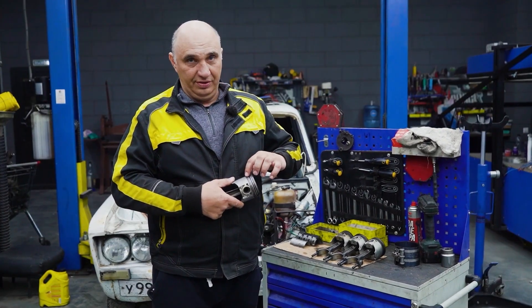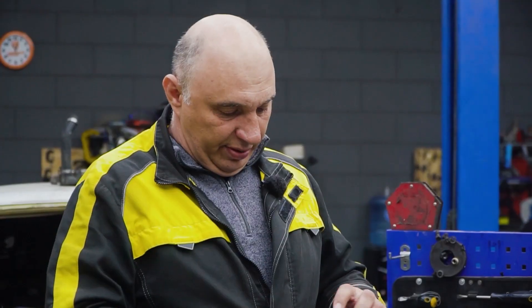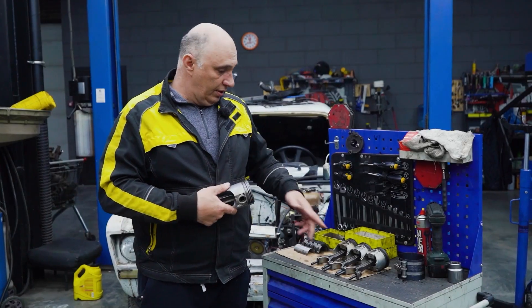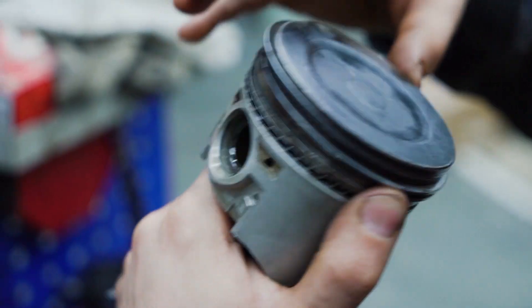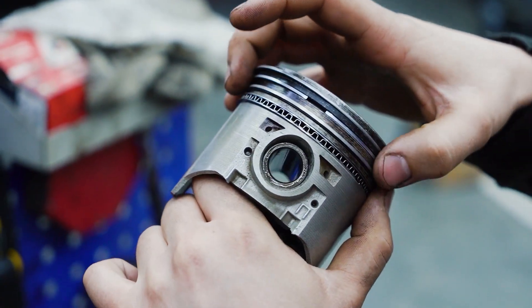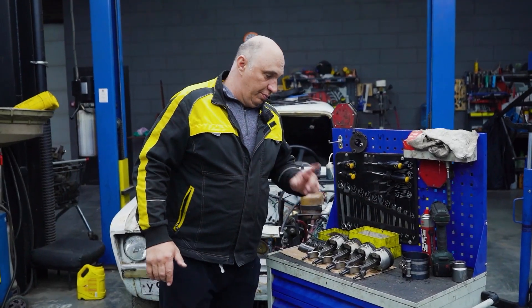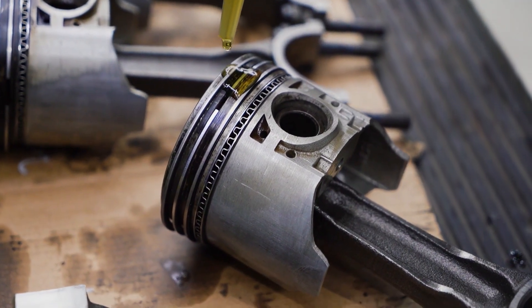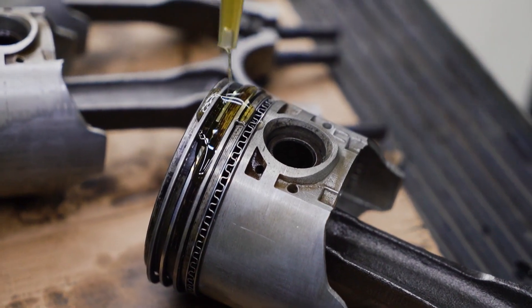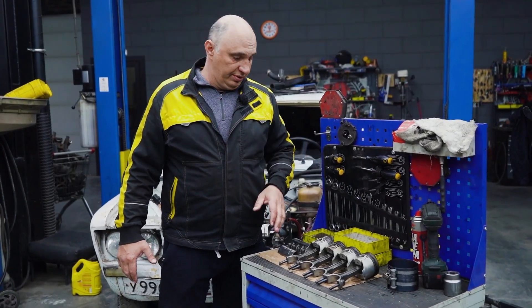This is actually a three-piece oil ring, consisting of two thin rings and a spring element — I've heard you can't even find these anymore. So we've got the additional thin compression ring in there. We've modified all four pistons. Everything moves around just like it should, with no trouble whatsoever — they're just sliding nicely within their grooves. We decided we're not going to be replacing the old rings, because otherwise we're not going to be able to determine whether this mod had any sort of effect.